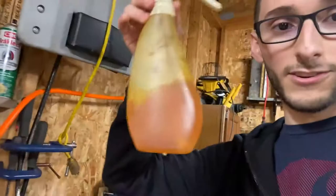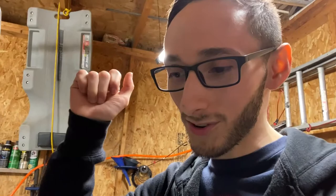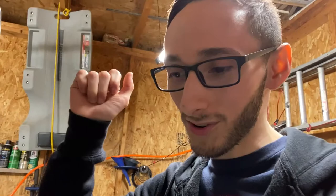You're going to need penetrating fluid. Get yourself a can, or even the whole gallon like I did. Spray everything down — every single bolt, nut, stud, everything — the day prior to doing the long tubes, and you're going to see that it's just going to be so easy to take everything out. You're going to be picking up the motor, dropping the front suspension — it's a whole mess, it's really not easy to do long tubes on this car.